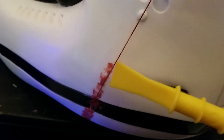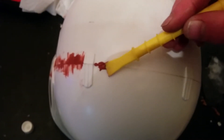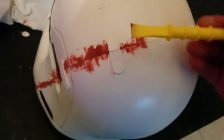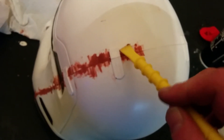I'm putting on a very small amount and being very careful to work it inside the crack. As I go along, I'm wiping the applicator tip off with a paper towel because this stuff dries quick and you'll get all gunked up. I'm working from the bottom of one side all the way around, spreading and pushing it into the crack, then smoothing it out and scraping off the excess. The smoother and more even you apply it, the less sanding you'll have to do later.